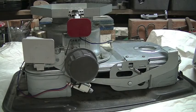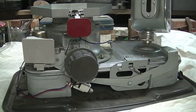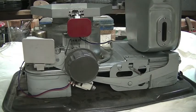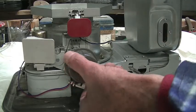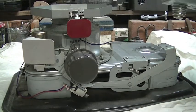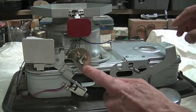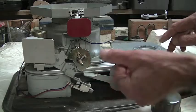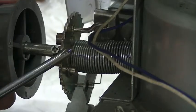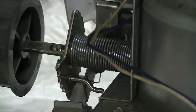So this is how the paraffin heater works. When you put the paraffin container in, that little cap goes into the hole there and it presses down on that lever. Only then can you turn the dial. As soon as you lift the container up it cuts out. And when you turn the dial you can hear that clicking sound — that is what it is. We hold down that lever and just turn that dial, and you can hear it clicking. Behind this wheel there is a spring button which helps the dial return back to its original position.